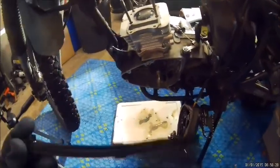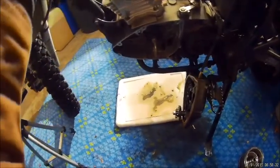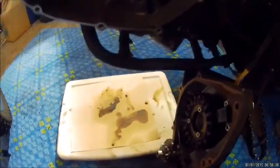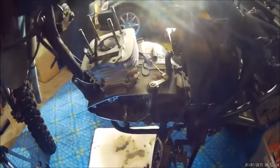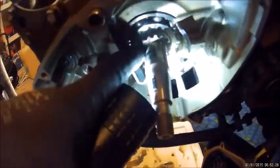The cylinder is on. Next up, you want to get the cam guide — the chain guide. There's a little rivet right here, so make sure this is on the correct side. You can drop it right down in here, but when we put on the head we'll have to rig it up, so I'm going to try to get it into these hinges.